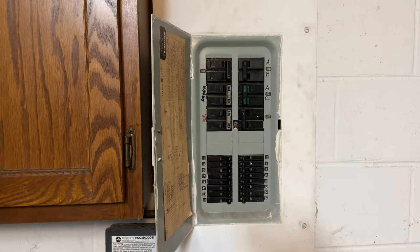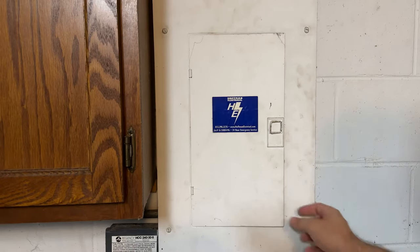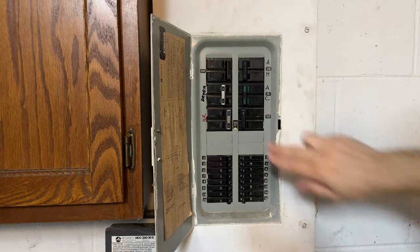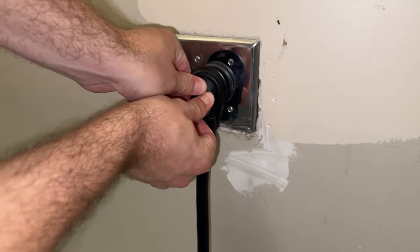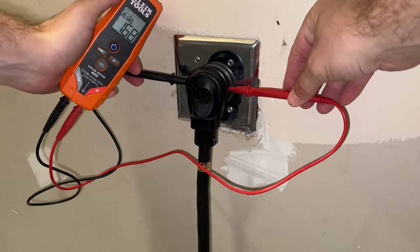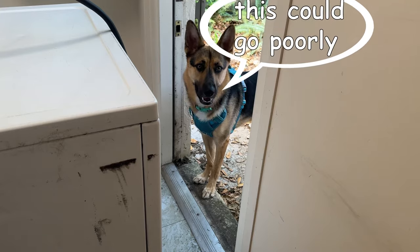To begin, I found a lot of recommendations that you should start by checking your electrical. I was skeptical that any of this would be the issue but thought it's free, so I'll go ahead and test it. I went to the panel, found the breaker for the dryer, flipped it off and back on. It didn't fix it. The receptacle for my dryer is one of these four-wire outlets. I used a multimeter to take readings off of the two hot legs and it read 240, so I'm pretty sure the electrical is fine. Standard disclaimer that electricity is dangerous, so be careful.